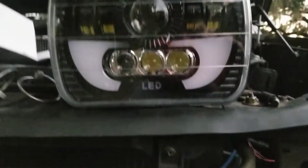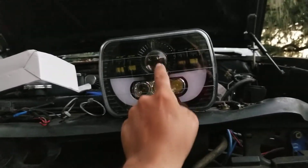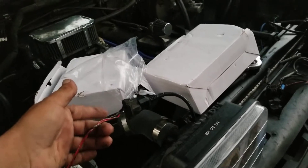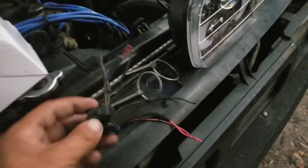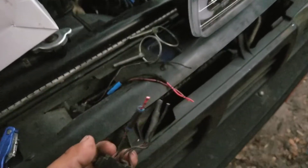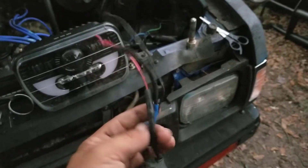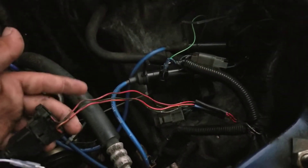The only bulbs that weren't on — this is the driver's side — these bottom three bulbs were on and so were the top ones, but on this side these three bottom bulbs weren't on. It's likely when I was redoing the wiring. I snagged the harnesses way back when from the '93 D21 that I was using as a parts truck, and these are the stock ones from this truck. This one was from the driver's side and it was in the most horrible shape of them all. I snipped it off and spliced in the harness from the '93 D21.